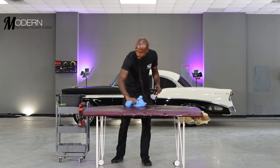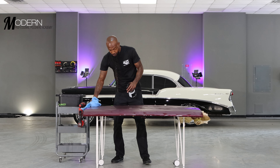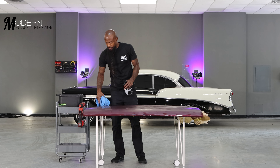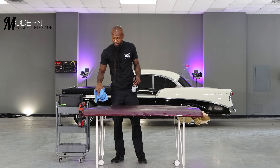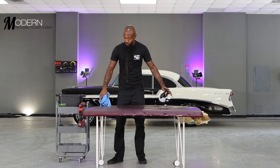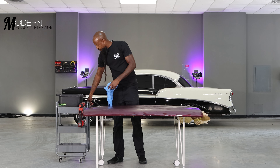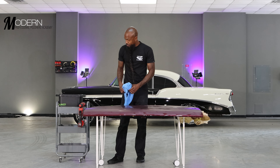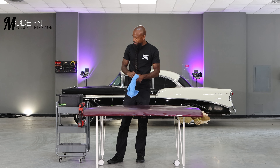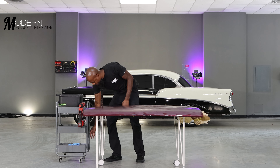The entire panel was gauging at overflow — more than 50 mils of thickness between the gauge and the bare metal — which lets us know we've got a lot of Bondo. Even up at the top of the trunk lid in the corners, it was reading 48, 59, 49, 48 and 49. So the whole thing is pretty much Bondo. It's a good thing to have your gauge ready, guys. Make sure you have a gauge if you're going to do any sanding, or don't mess with it at all unless you really know what you're doing.